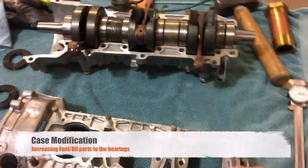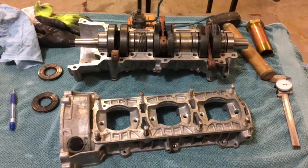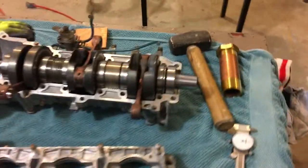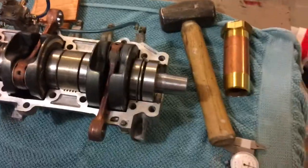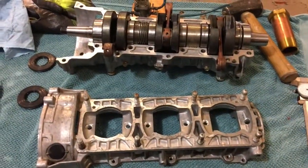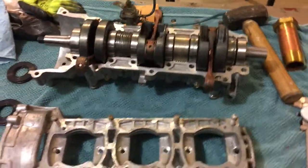Okay, so just a little extra features and tips here on this 600 XLT rebuild with the crank bearing replacement. These two bearings here are the ones that had failed. This machine, for as long as I've owned it, which isn't all that long, it's the first time the crank bearings have been done. And I say that based on how difficult they were to get off the shaft.